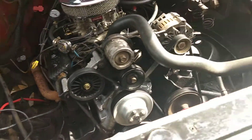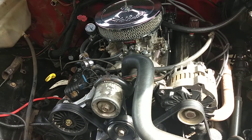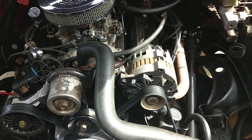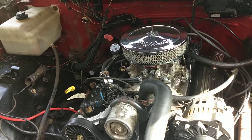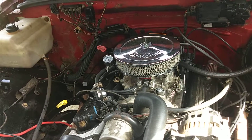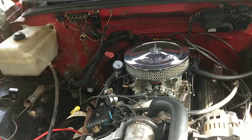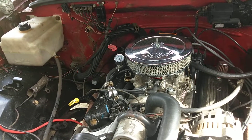I'm also looking at getting a bigger amp alternator — I've seen them from 140 amp up to 180 amp. I really don't know what the factory one is; I imagine it's probably around 120 to 140. I'm also looking at an Air Gap Edelbrock intake for the Vortec that a guy has for sale on Facebook. It's a really nice-looking intake, brand new with the box and papers. He wants $150 — it's almost a $300 intake — so I don't know if I'm going to splurge for that or not.